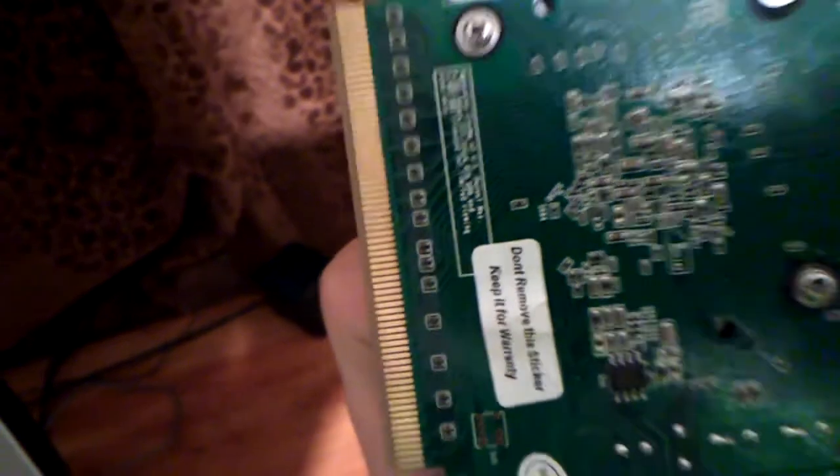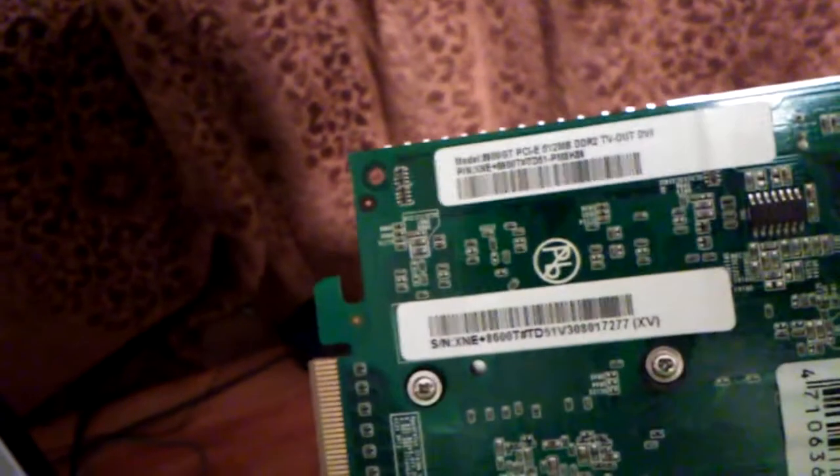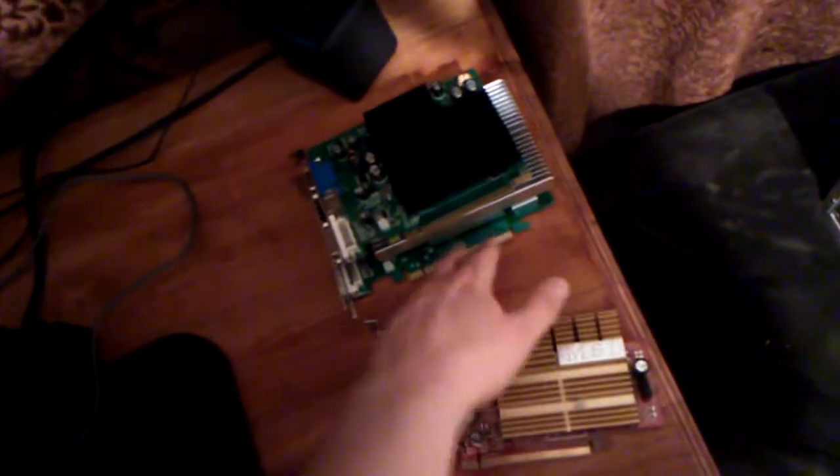Oh, it's the 8600 GT. So actually this could be a strong card, but I know it's using DDR2 memory. It's there, like 512 megabytes. I still think this is the strongest unified shader architecture, while these are having like 12 pixel 3 vertex shaders, and I don't know the 7300 GT, how it actually, it's a 7300 GS, so even slower. I think it's like a 64-bit memory bus, and yeah, it's a slow card. I also think this one is 64-bit as well, and that's why it's slow, because of the memory.